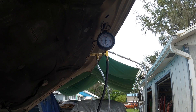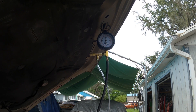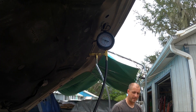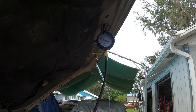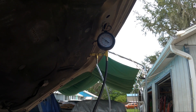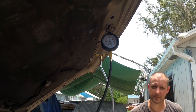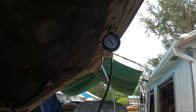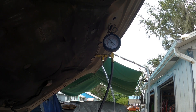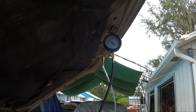Okay, as promised, we're going to test fuel pressure real quick. So that's key-on, not cranked - we've got 52 pounds. And we're at 62 PSI at idle, so 62-63. I'm going to say we're pretty healthy there. I'll just have to do a load test later where I tape it to the windshield, and that'll probably be tomorrow because it's about to rain - it's actually sprinkling on me now.